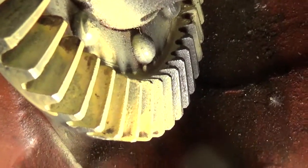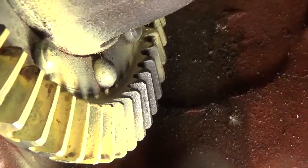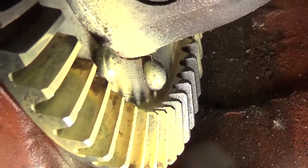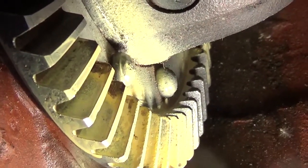One final note for tonight. After monkeying around with the shims on the differential bearings, I wanted to make sure that my mesh was still good. So I went ahead and painted some new gears and rotated them through. They're spot on — I was delighted about that. Oddly enough, it's the things you worry about when you're traveling. But it looks like the mesh is good and the backlash is good.